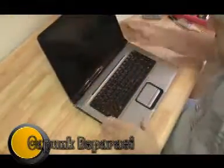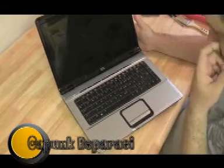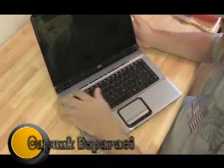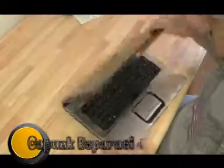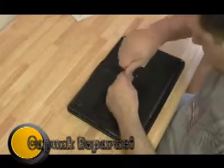I'm going to do a motherboard replacement here on a HP DV6000. Here's what happens when we press the power — nothing on the screen, and we get a couple of beeps. Now it could be an error code. You can check that on HP's website to see what four beeps mean. But we already did that, we tried replacing the RAM, and it's definitely a motherboard problem.